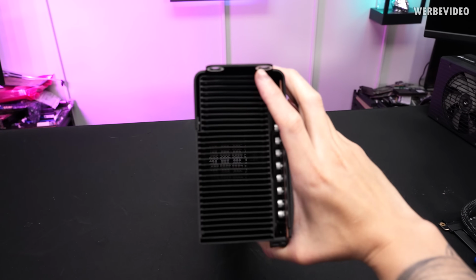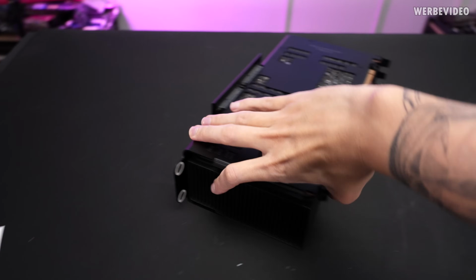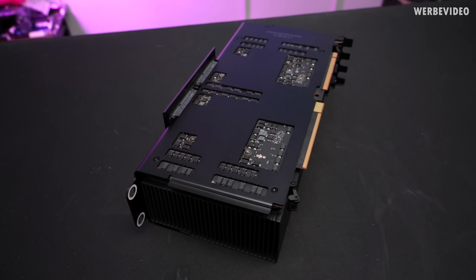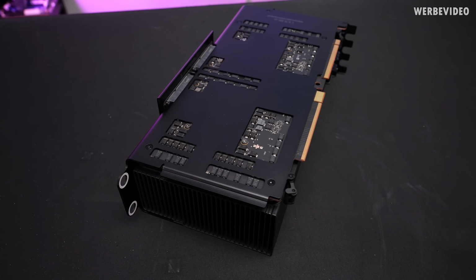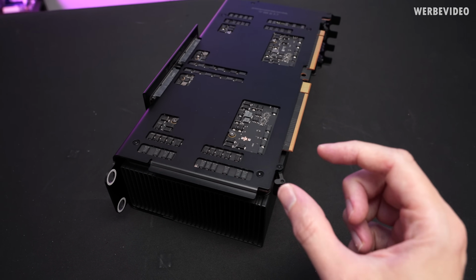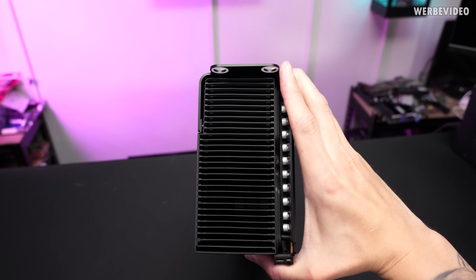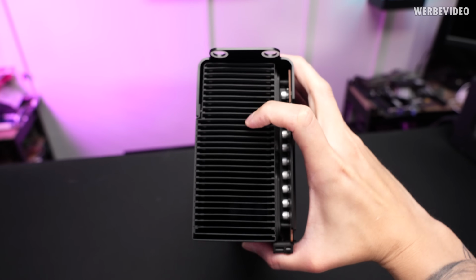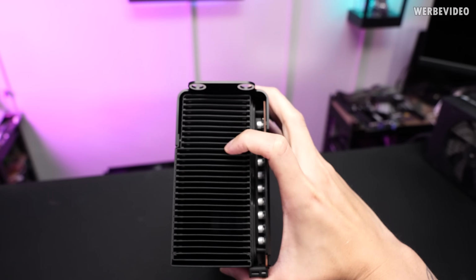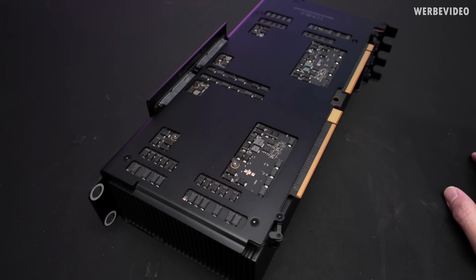And that's just because that's how the Mac Pro is designed. So you plug it in and then we have some fans on the case that is pulling the air through the card. And that's probably also the case why we have this rather wide fin stack. It's a lot of surface area, but it's not very fine. And that's, I guess, because they just want to avoid that the fans have to spin at a high RPM to push some air through.